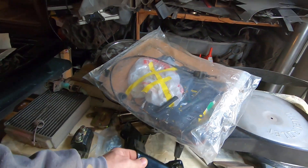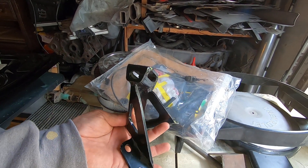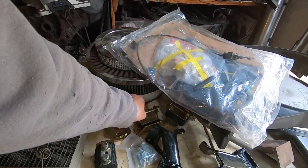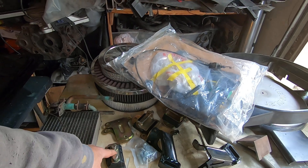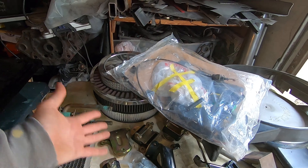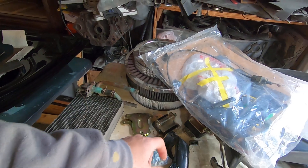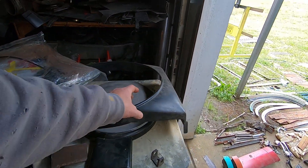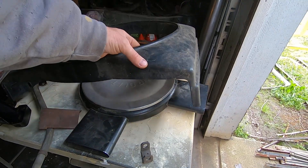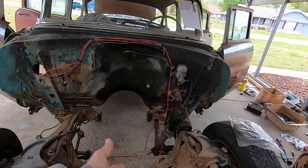That's what's going into the car. I have a side engine mount kit I got off eBay a long time ago — been new in the box. This moves the engine three-quarters of an inch forward for HEI distributor clearance. I have brand new Energy Suspension urethane engine mounts and a transmission mount — I had those on a car for mock-up but never finished that car, ended up trading it off, and I got to keep the engine, trans, and that stuff.